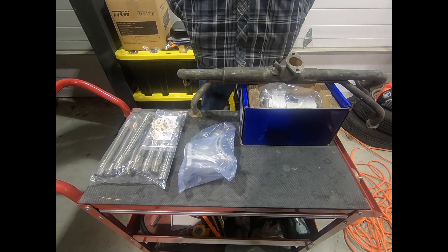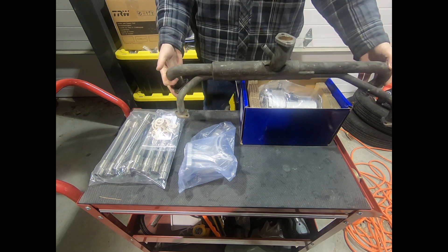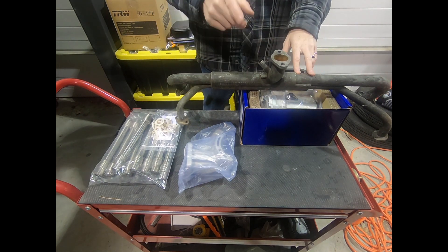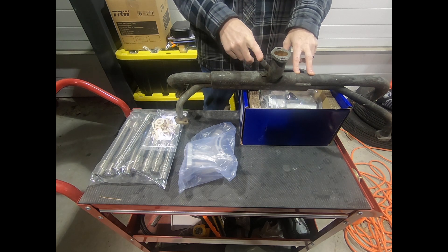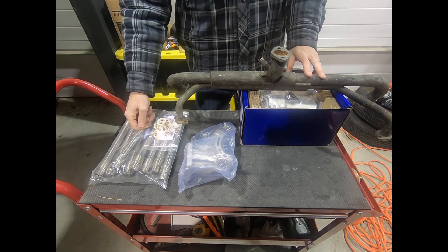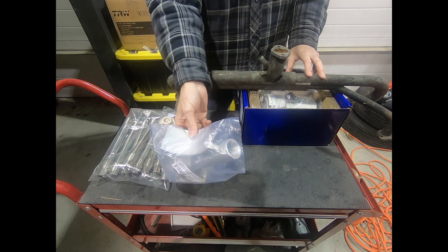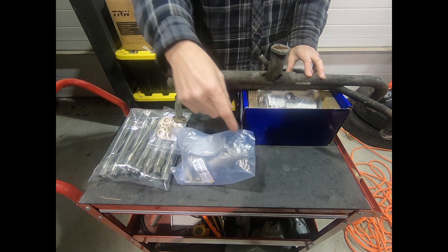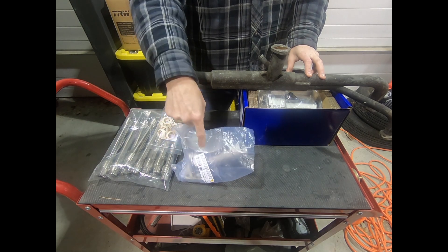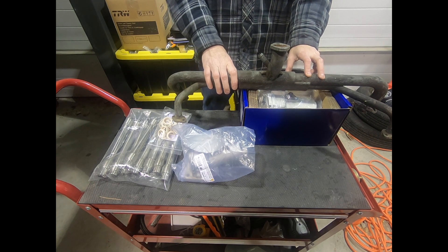Tonight on GarageTime we're going to show you how to tear down your 1500cc Volkswagen Type 1 engine. We're tearing down the engine today because we had a vacuum leak on our manifold. It is a semi-automatic that we're ripping apart, and vacuum is very important on the semi-automatic, so we are replacing our manifold. We also had lots of leaks with our pushrods, and we have a new alternator. To replace the generator on a Volkswagen you actually have to put in a new stand, so here's our replacement stand. Let's get over there and start taking it apart.